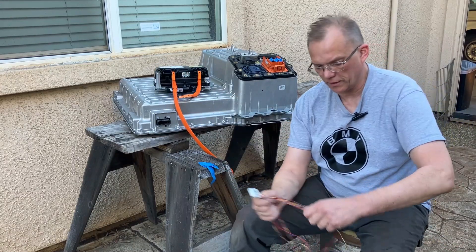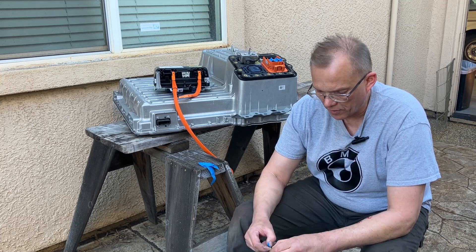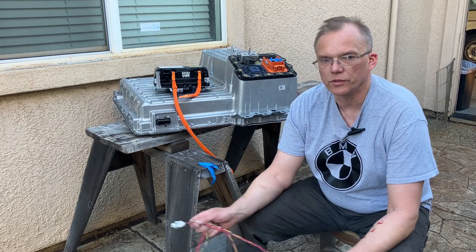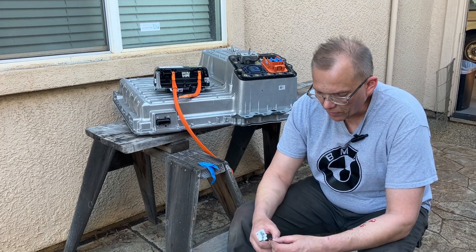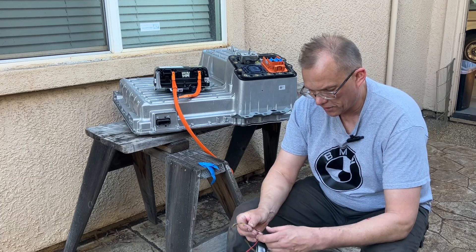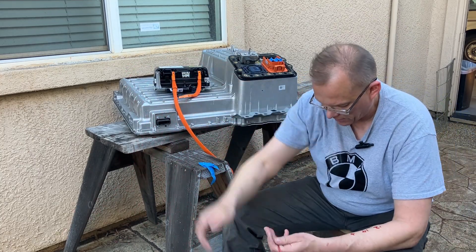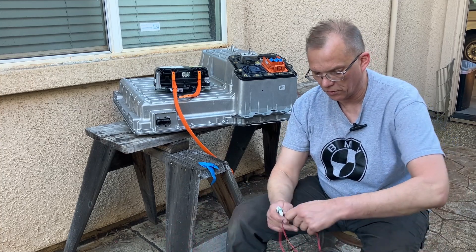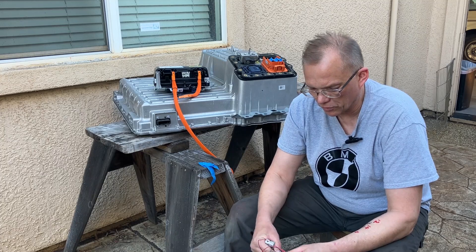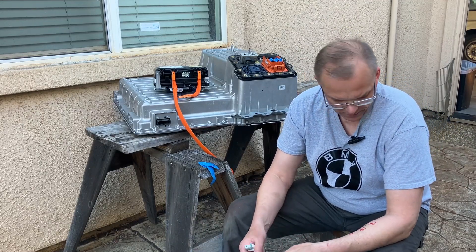I like to remove all the conduit from the wires. I've had cases where wires would change colors midstream inside the conduit — they'd just switch from yellow to blue or something. Off of here we have two reds; those are going to pin 12 and 14, and those are going to be our positive leads. The two reds will both just run to positive — we can use positive from the battery. I think this will handle 12 volts. Always use a fuse. And then there is pin 3, which is the ground.